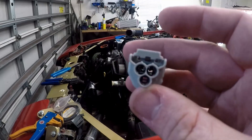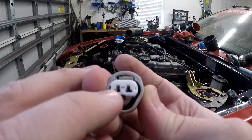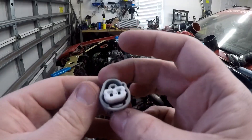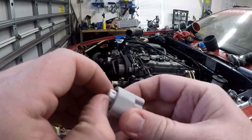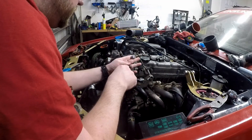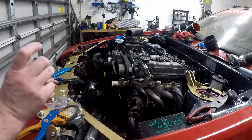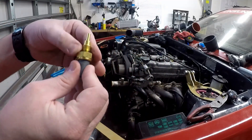Now that we have our pins crimped on, the question is where do the pins go? The stock wiring goes to the top pins, and the wire for the gauge goes to the bottom one — whichever way you look at it, pretty much the one on its own. That's going to be where the wire goes for your coolant temp gauge. Keep the connector popped out until you've got all three pins pushed in, then push it back and it locks in place. All three wires are in place — push that back, there you go. Now they're not going anywhere. The two top wires — it honestly doesn't matter where they go because it's just a resistor. This is sealed with a copper o-ring gasket, just put it on there and tighten it up.